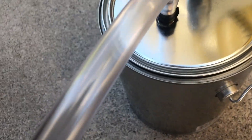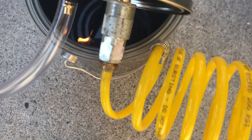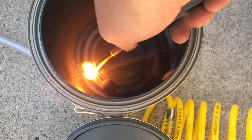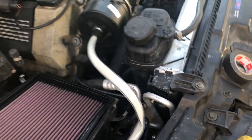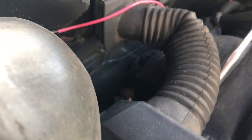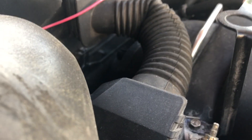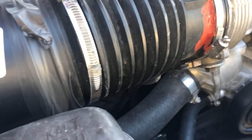We're all hooked up. We've got a smoke ball — lock that in there. Light that up. Should really start smoking up. We've got smoke going. Got some smoke coming out, and there is the culprit. See in the rear there? That looks like a hose that either came out or was unplugged at some point and didn't get re-plugged in. There's also a small leak right here.